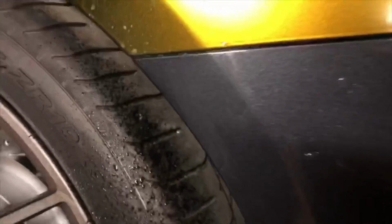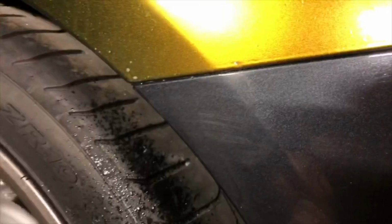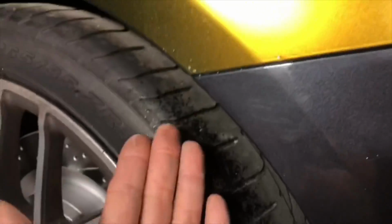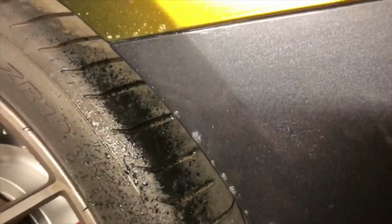On this side, this has been sanded, so as you can see, the paint layer is still good. I only got rid of the clear coat layer that's flaking. So yeah, this has been sprayed with water, so it doesn't look as bad. But once it's dry, it kind of looks hazy, because of course, if you sand something, it's going to be hazy until you re-clear. Essentially, when you clear coat something, this is what they do. It's basically wetting the paint layer with the wet layer of clear coat is what's happening. Okay, now it's ready for wrap.